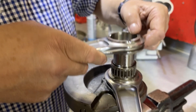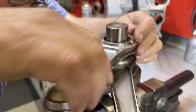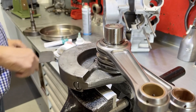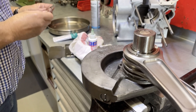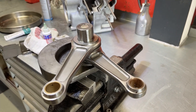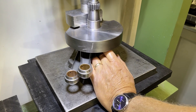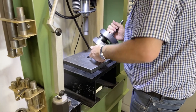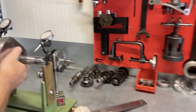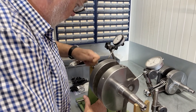We discussed the preparation that goes into this before we can actually fit it. With a thrust washer on either side, we can then move to the press again to put the other crankshaft web in place, making sure it is all properly aligned as we go along and also after it is put together. That is done using this special jig that we use to measure the alignment.